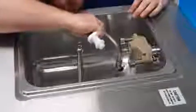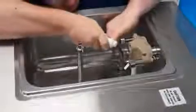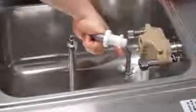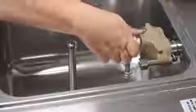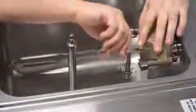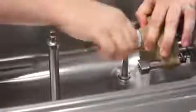We'll connect the feed tube by starting it into its slot and then push down as you turn back toward the pump until it drops into the locks. You'll push it past the retaining stud on the pump, turn slightly, and pull back to lock the feed tube in place.